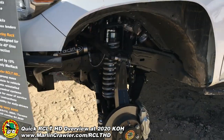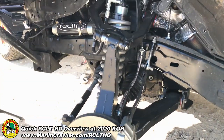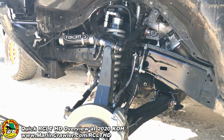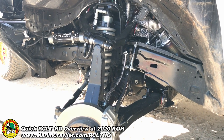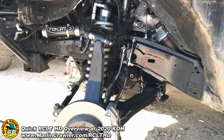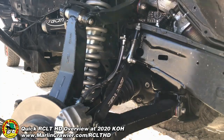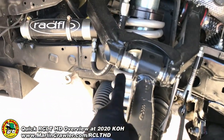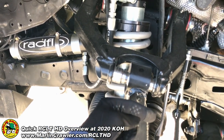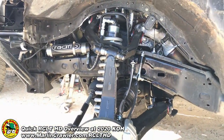Here we are — it's a little dark. So here it is: Version 3 prototype, installed two days ago, drove it here to the Hammers. With tailwind, I made 22 miles per gallon with 40-inch tires in this V6 3.5-liter 2016 Tacoma. The kit is coming together really nicely. You can see here how I've got the caster double-stacked — I'm trying to gain caster by kicking the knuckle back, which is important because of how much I have this truck lifted to clear 40-inch tires.